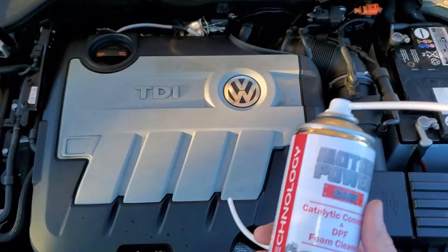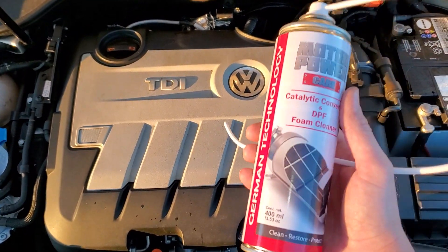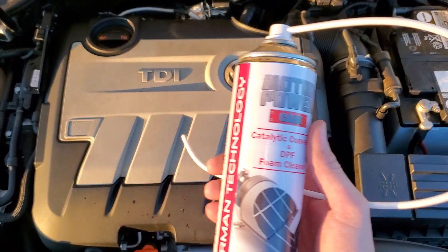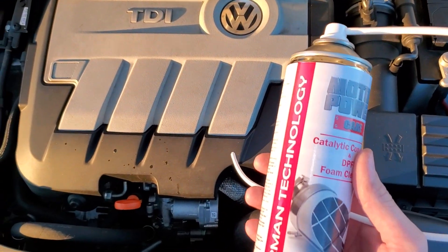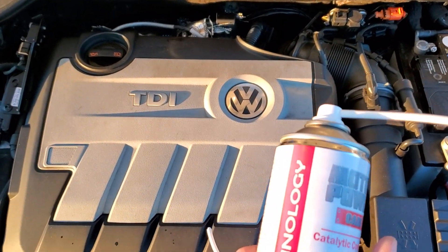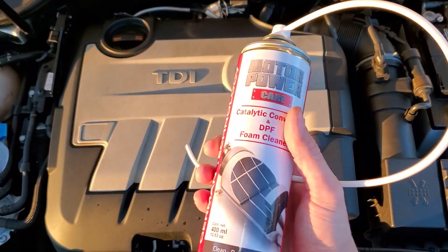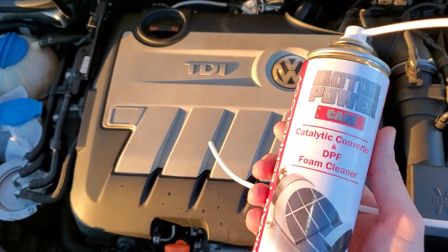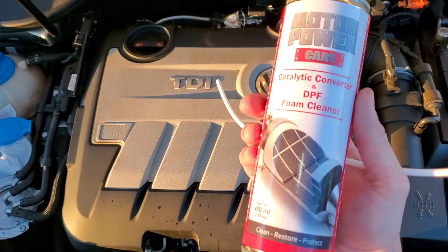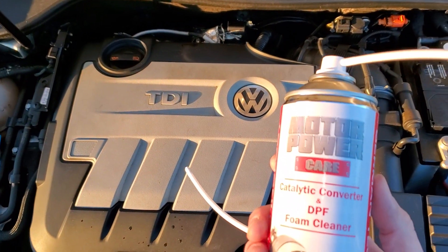Take it for a 40 to 50 minute drive without stopping, slowing down, or speeding up. Put it in cruise control, fourth gear, 60 miles an hour for 40 to 50 minutes without hitting the brake or the gas. I watched the OBD reader and the computer told me the regen for the NOx sensor desulfurization happened — after that, everything was good. My regen happens all the time, but over 40,000 to 50,000 miles, heavy metals accumulate in the DPF that cannot be cleared with regen alone. That's the purpose of these cleaners — they recommend using them every 3,000 miles. I saw a noticeable difference inside the DPF even after the first can.